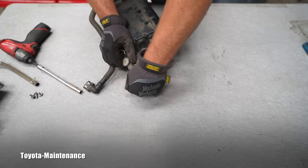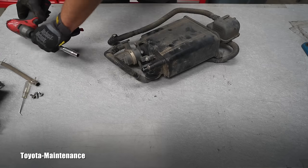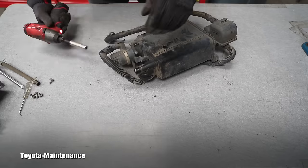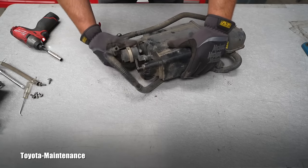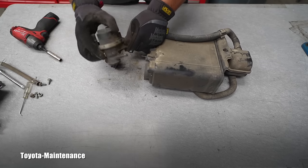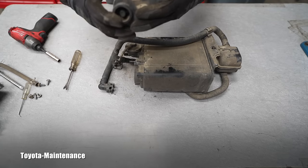It comes off and there will be a gasket. Everything is super dirty because, as you remember, I filmed that replacement for everybody. This is underneath the car towards the back where the rear suspension is, obviously exposed to all the moisture, dust, dirt — everything that's on the road. So basically this is the electronic unit right here, still connected with this very short hose which we will remove right now. That always helps to get hoses off these pins — and here we go.